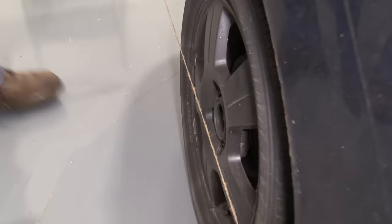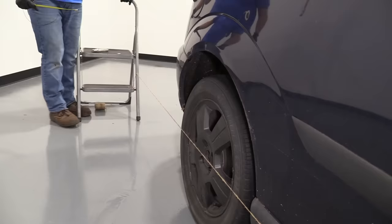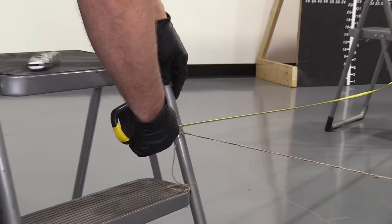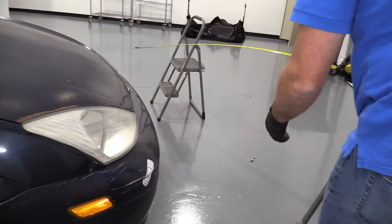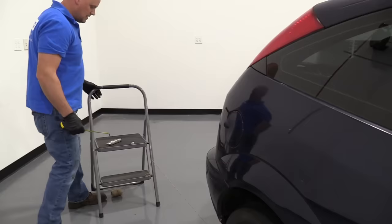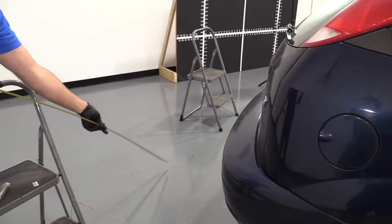This one is about an inch and a quarter, so we're going to move it back a little bit to get it closer. That looks pretty good. Before we make any adjustments, we're going to measure in between these two strings. With the tape measure, we're at about 66 inches at the rear, and about 67 inches at the front. So we're going to move the back out a little bit to square it up — that's about 67, so that's good right there.